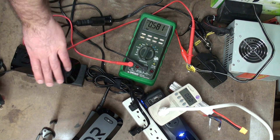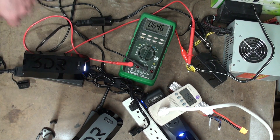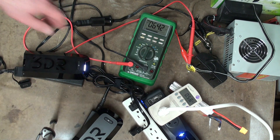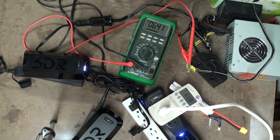Plug in a 50% battery to charge. On the AC side, 0.57 amps. On the AC side, we have about 60 to 61 watts. For DC current, 6.41 amps. Right now, that's 6.41 amps DC current draw.